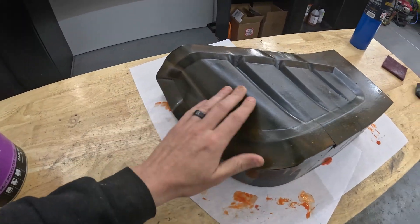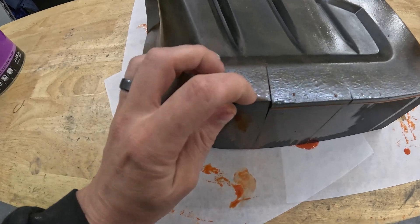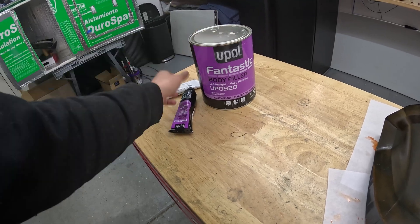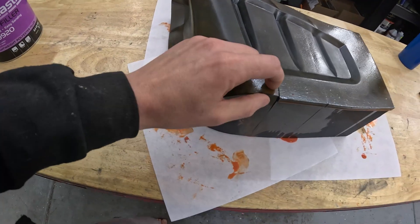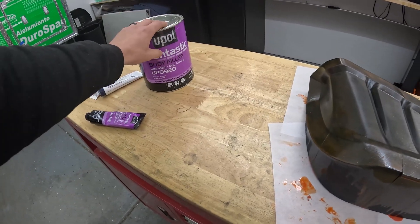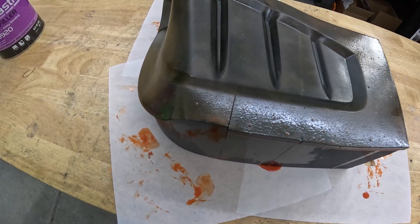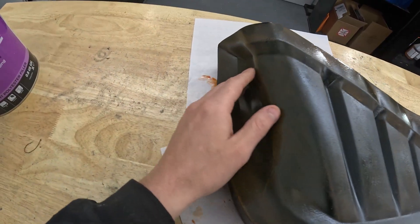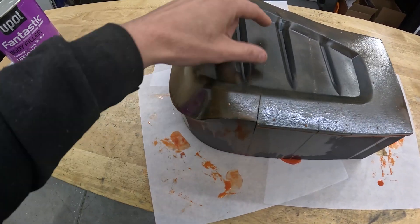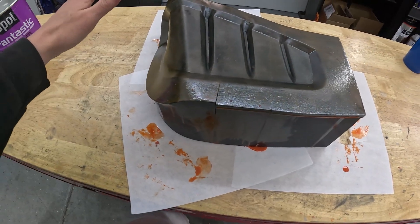This has finally cured and is looking pretty good. The only thing I'm concerned about is this gap — I kept adding more and more resin into it during the video and it's still not filled. So I'm going to use some body filler. You could use glazing putty, but because of the crevice, this stuff mixes with hardener and it's a lot more trustworthy to me. I'm going to fill in these two little crevices. Everything on the actual carbon surface where it's important is wonderful — there are no gaps. This is just the flange area, so I'd rather have a gap here than there. I'll quickly touch this up and then it'll be ready for primer.